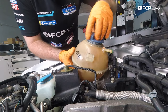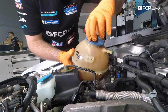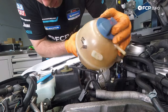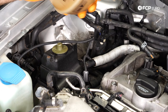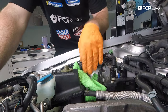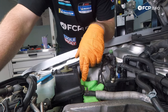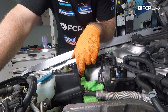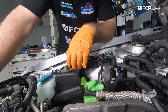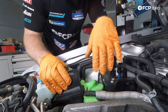We're going to put the cap back on so it's not lost. There's one more hose on the bottom here. You may be able to work around the power steering reservoir, but I'm just going to go ahead and get it out of the way. I feel like it's going to make more room and better access — especially for showing how to do this in the video and getting better angles with the camera. Pretty simple — I'm going to remove this hose, keep the other one on, remove the securing bolt, and swing it out of the way.